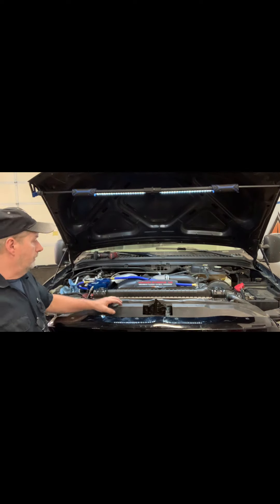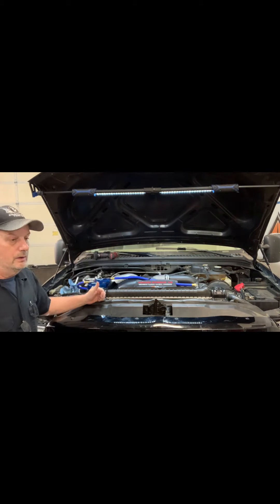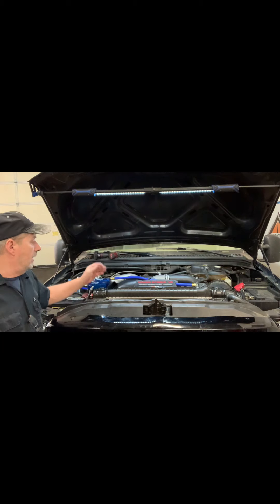This is really two systems in one. In the front we have the restrictor tube, and in the back we have an H-valve or thermo-expansion valve. So I pulled the system down and pulled the valve out.